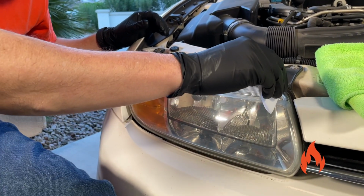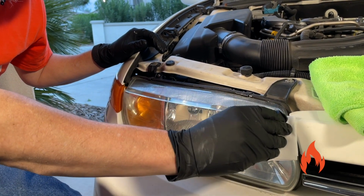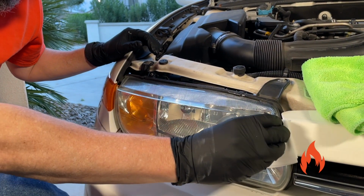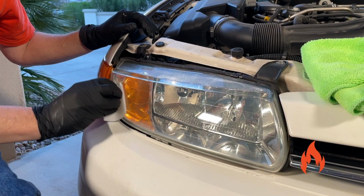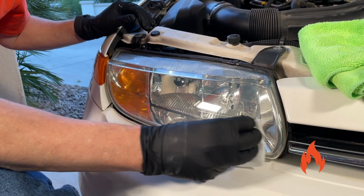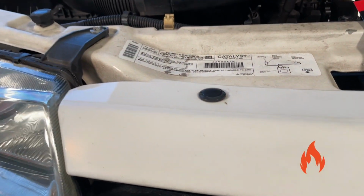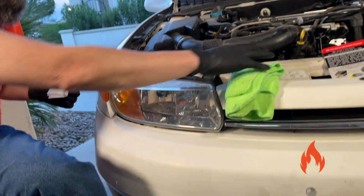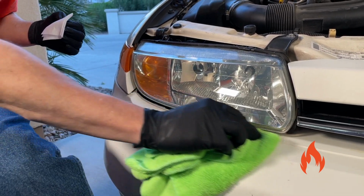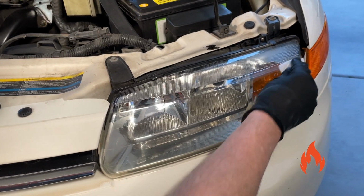Do not unfold it. With light to moderate pressure, wipe in a horizontal path, starting from the top of the headlight, from one corner to the next. Repeat another horizontal path wipe with slight overlap from the previous, working down the headlight. Do not go back and forth over previous path lengths and do not wipe the coating off the headlight. If any excess coating gets on the paintwork or surrounding area, simply wipe it off with a microfiber towel. Coating will be tack-free within 15 to 30 minutes, depending on ambient conditions, and cured within 1 hour and free to expose to the elements.